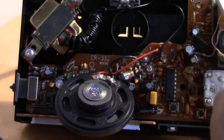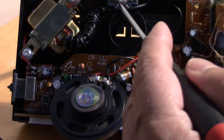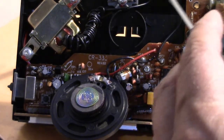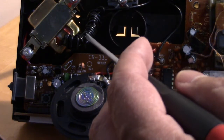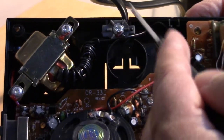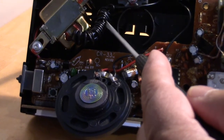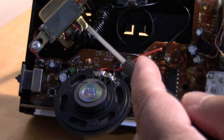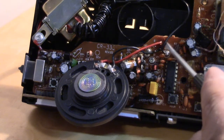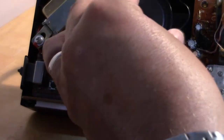The interesting thing here is there's a black wire that goes up and is wrapped around the power cord — that's the FM antenna. Basically they're coupling the FM antenna to the power cord, so the power cord becomes your FM antenna. The FM wire is coiled around the power cord and makes its connection on the circuit board. I thought that was pretty interesting — kind of an old trick.